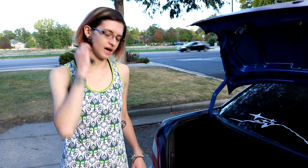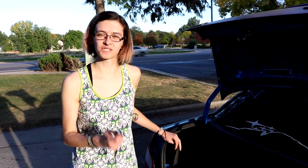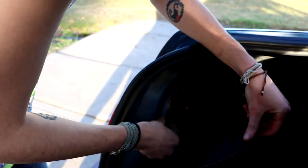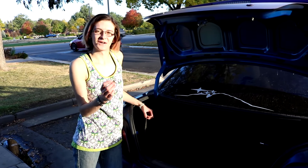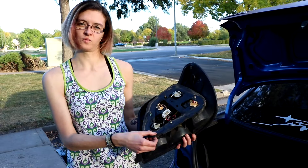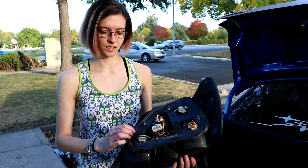First we're going to remove the plastic tabs that hold in the liner in your trunk so that we can get to the taillights. Inside there are four bolts and they're going to be 10 millimeters — just need a socket wrench. Once you get your four washers off, there's a white plug inside that you'll have to unplug so you can pull your taillight out safely. You'll notice there's a foam rubber gasket all the way around the electrical wiring that sits flush with the body of your car to keep moisture out of your lights.